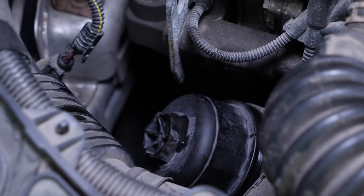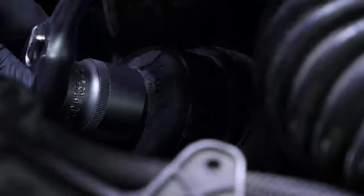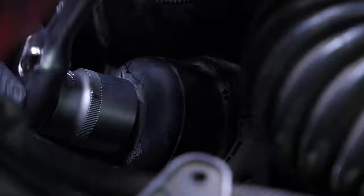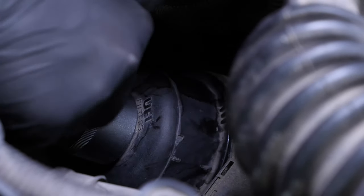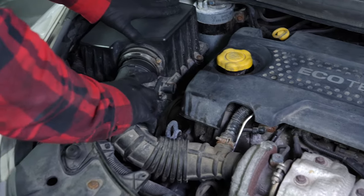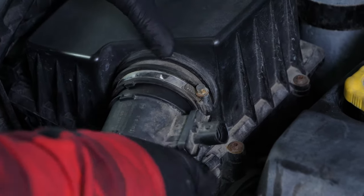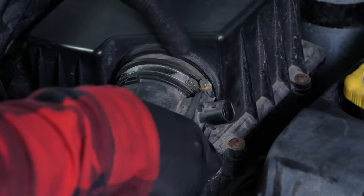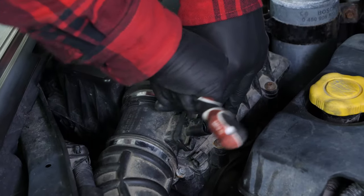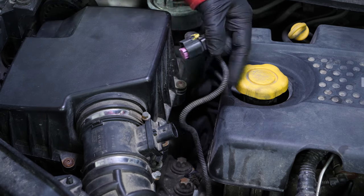Careful! With this kind of oil filter, the new joint can be excessively thick, making the actual tightening process more complicated. As a result, you have to ensure that the flange washer is flat against the metal engine frame. Don't force it too much as the part is fragile. Reassemble the air supply conduit and tighten the metal clamp. Clip the cable back onto the air flow meter connector.